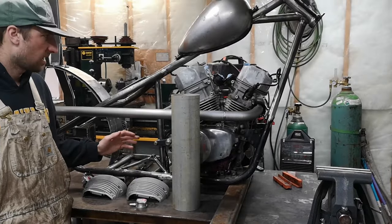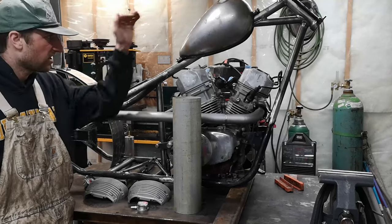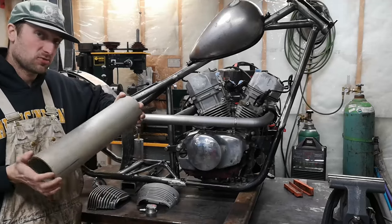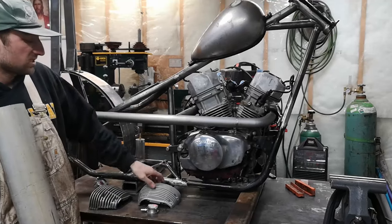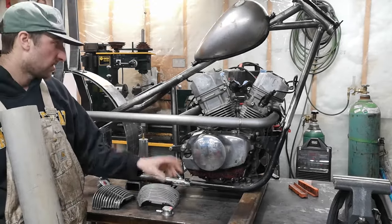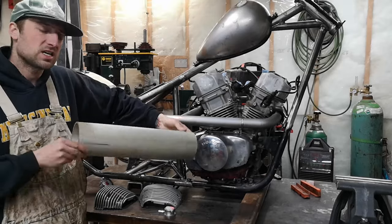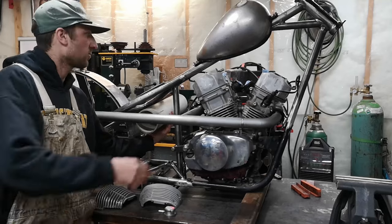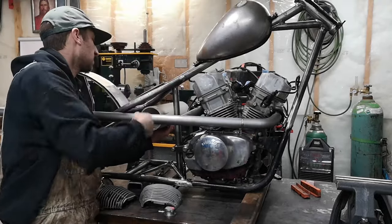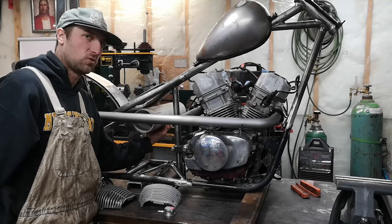Nobody loves radiators, right? That's where these kind of get shit on — they've got the radiator up front. So I'm going to do a little bit of experimenting here. I found this tube in a scrap bin. I'm going to weld cooling fins onto the side, weld on a radiator cap, make some hose fittings, and we're going to make a radiator delete. This is going to tuck in underneath here, and instead of the hoses going forward to the radiator, they're going to come backwards to this big heat sink, and we're going to see if it'll be enough to cool this motor.